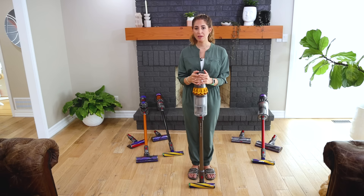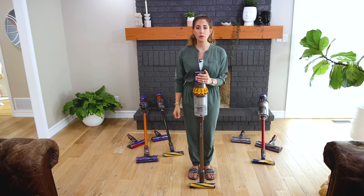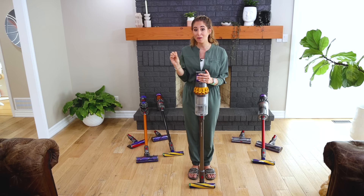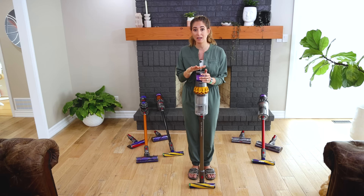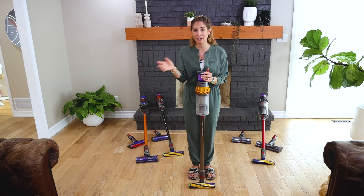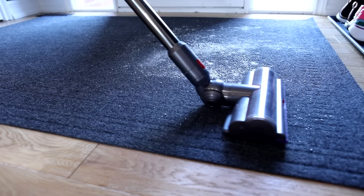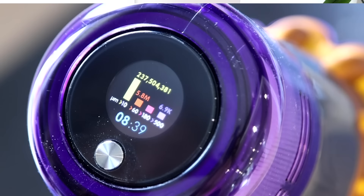The piezo sensor took me a minute to wrap my head around, but once I got it I got it. There is essentially a mini microphone in the bin that listens to the dirt coming in. It can separate out the size of the dirt by microns, which helps the vacuum determine how heavy-duty it needs to be on suction when in auto mode — optimizing your battery life. The second thing it does is give you a visual confirmation on your screen of how much dirt you are actually picking up. We cover this in the linked video in quite a bit of detail.